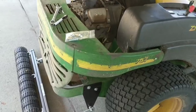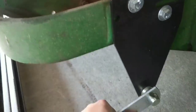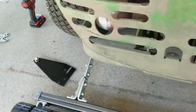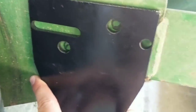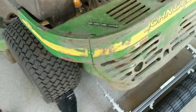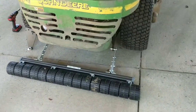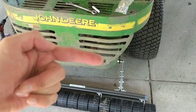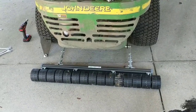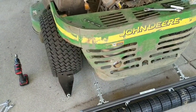Had to pick up on the next day — I ran out of daylight yesterday. I wanted to show everybody what this quick release looks like. There's a pin that goes in and locks, kind of a cotter pin type deal, and I'm getting ready to mount this bracket. One thing I learned — and thankfully the Checkmate team is very responsive with customer service — is that both male pieces of the quick connect, meaning the side the cotter pin goes on, need to be facing in the same direction, or you're gonna be hard-pressed to get it off.